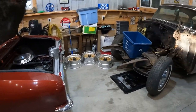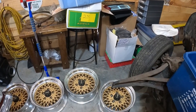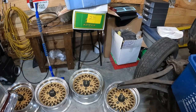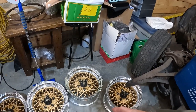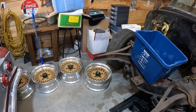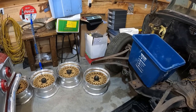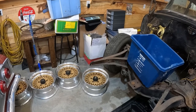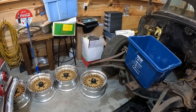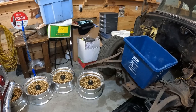Corsa, of course. Got these wheels. A friend of mine set me up with them. Really looked after me. So I got to get tires mounted on them. They're 14s by 7s. Now, tires are a little tricky to get right now. So what I've got is I bought some 185/60R14s, and I'm a little concerned about width. But if they don't look like they're going to go well, then I'm just not going to use them. I'll return them and order the correct ones.